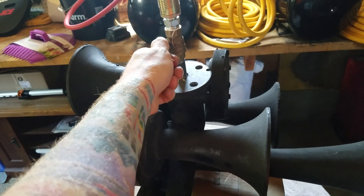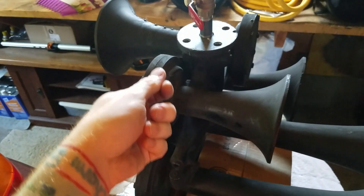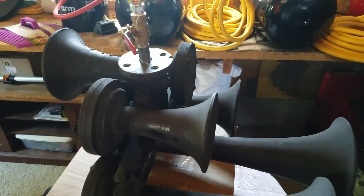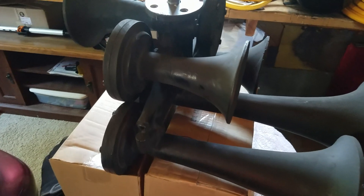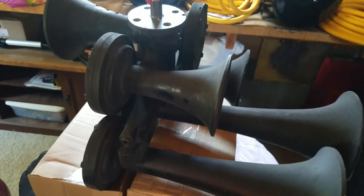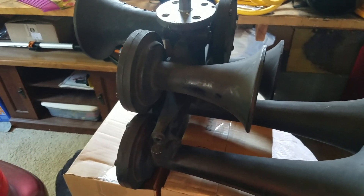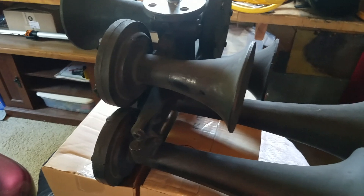Sorry if that was an ear killer. It's not too bad — I've had horns leak a lot worse. Nothing seemed too lazy to shut off after I shut the air off; I didn't hear any elongated squeaks. So I'm probably going to try and use a lot of the original parts on this, even the diaphragms. They do have a decent wear line where the nozzle is given how worn some of the nozzles are, but I'll really try to make sure even the diaphragms go in facing the way they were after cleaning.